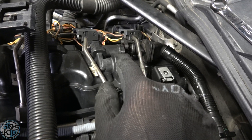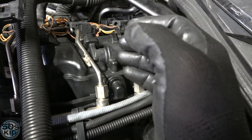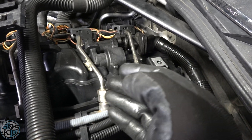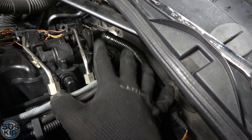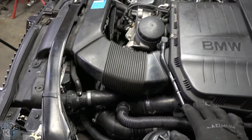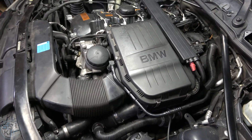The problems with this system occur when the check valve doesn't shut all the way, which means it won't prevent boost from leaking back into the valve cover. If excessive boost pressure leaks through the PCV valve into the valve cover, it forces a lot more oil and vapors out of the valve cover to be recycled back into the engine — that's what causes excessive oil to build up in the intake track, make its way into the intercooler, and get sucked back into the charge pipe. We saw evidence of that when we did the walnut blasting last week.